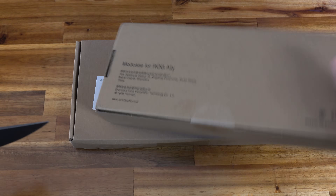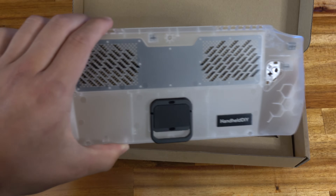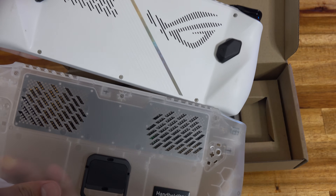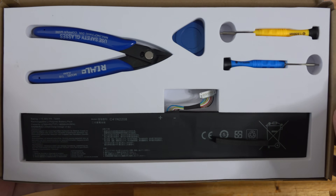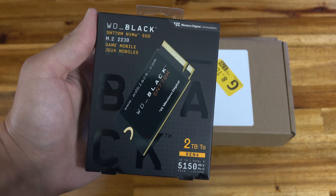I have all the mod equipment to get this build underway. For this build, you're going to need three parts — I got all three on Amazon and I'll leave links below. First up is the handheld DIY backplate — I got this transparent clear one, and you can see it has way larger vents for cooling compared to the stock base plate. Next up is the 74 watt hour battery pack. This kit comes with the battery, a set of clippers for trimming your case, a few screwdrivers, and a guitar pick to pry it open. And then lastly, I have this Western Digital Black two terabyte 2230 drive.